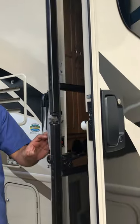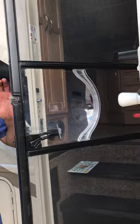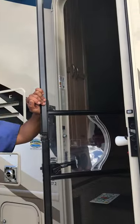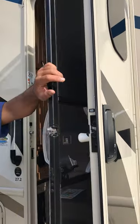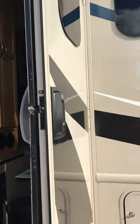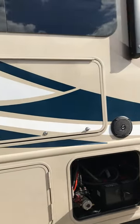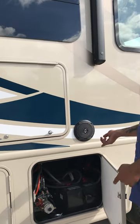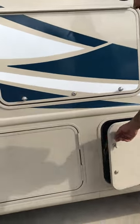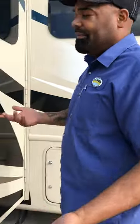Is there an idiot light on the dashboard saying your batteries are charging when you're driving? So you won't know your batteries are dead until they're dead. Well, if you carry a voltmeter with you, you can just test them every once in a while. Then turn the engine on and test them. If they go from, say, 12.4 to 13.6 when you turn the engine on, you're good. Charging.